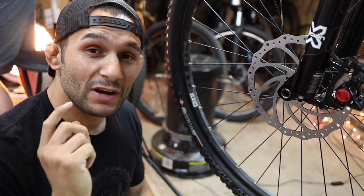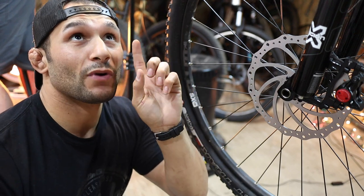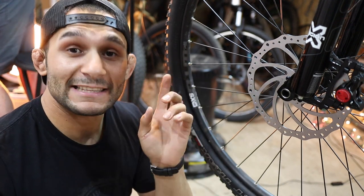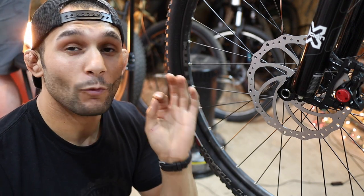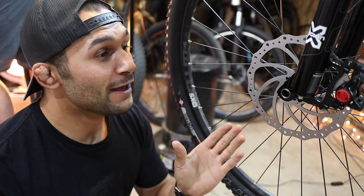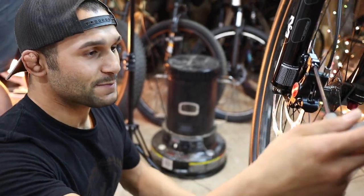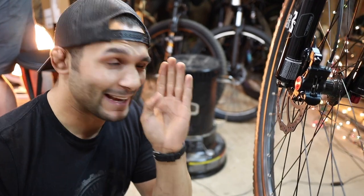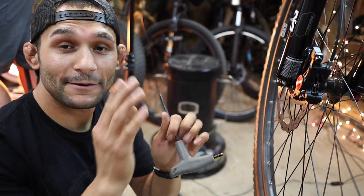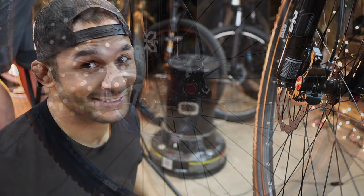Now I'm going to say something probably not that popular of a statement. Most people say, 'Oh, all you have to do with your rotor — keep your bolts loose, squeeze your front brake, and while you hold it, tighten down your bolts and it will be set. There will be no rubbing.' Well, guys, that does not work worth a damn. I'm tired of hearing it — it doesn't work. So what I do — and I'm not a professional — I tighten it a little bit, I spin it, I get a good eye's view of where it's open on the backside of the caliper, and then I use my tool and give it little pecks here and there, get it nice and straight, squeeze it tight, and go from there. That whole squeezing crap is for the birds.